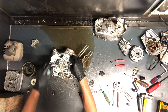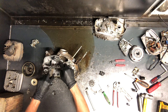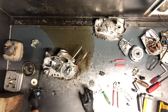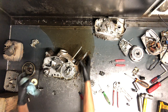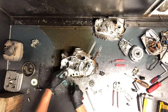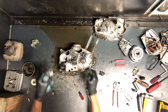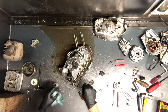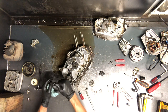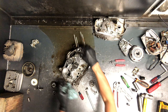There's a spring that sits in behind there. Now this shifter runs from the other side — you can see this was holding it up, so as soon as we undid it from the shift drum, we're able to just pull that shifter out. The kickstarter on this model you kind of have to disassemble — pull this center piece out; this holds that spring in place. The shaft won't come out until you split the case. This spring is obviously spring-loaded, so be careful removing it. Now it'll be able to come out the other way when we get that case split.